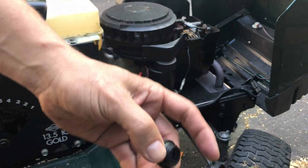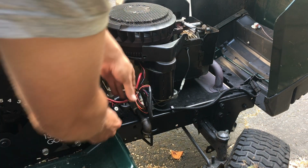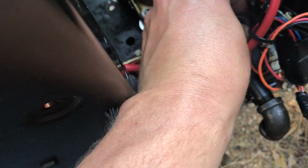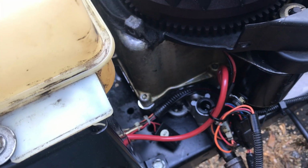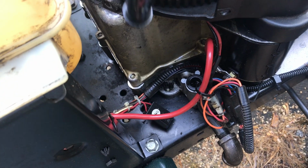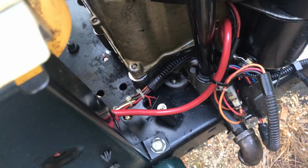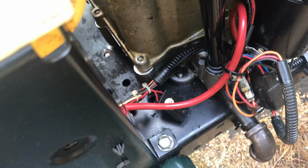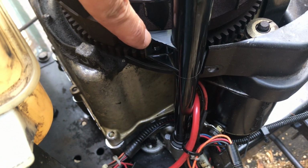So not too bad. So I'm going to go ahead and put this seal back in at the base of where the dipstick tube screws into the block. I realize you guys can't see. Let me try to get you in there better. So this thing just threads in. Thread it until it stops, and then take our new dipstick tube and just give it a little pressure and put that thing in there. Line up the hole there, so you're going to be able to mount it back to the engine cover.